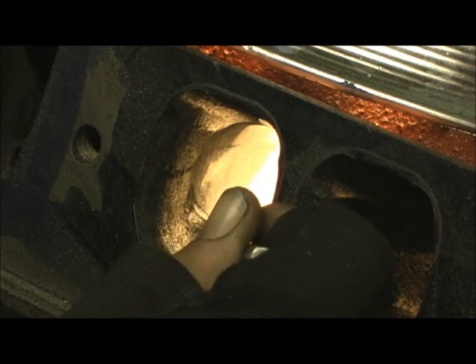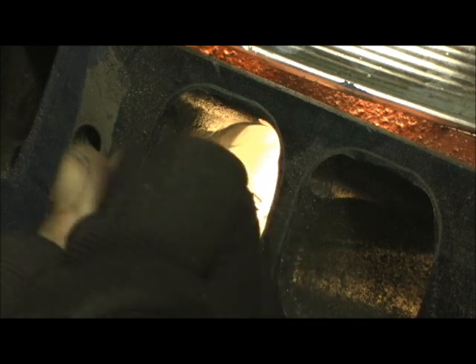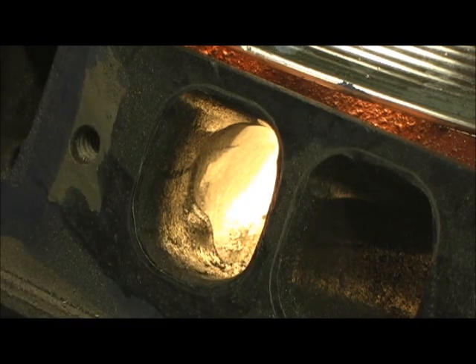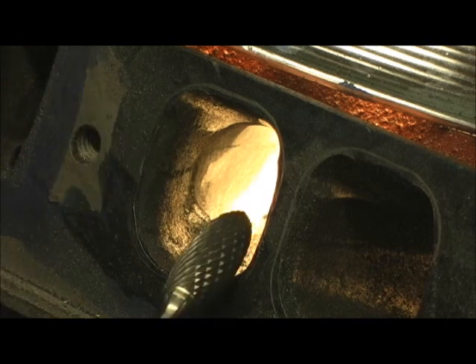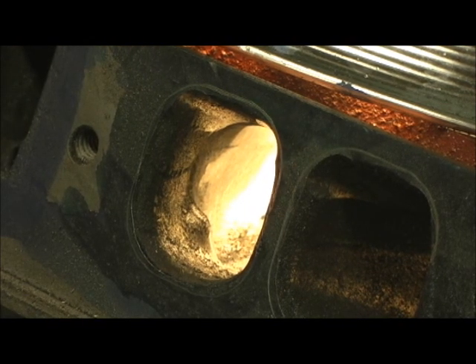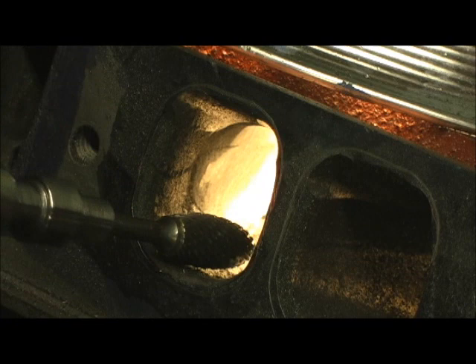What I'm going to show you is how I go in here while I'm cloverleafing and just take that whole son of a bitch out, then form the trench here and here. There's also a center cut to make it balance out to the port on the side, which has long been a problem associated with the big block Chevrolet head. So first we've got to get the butcher hog, go in here, and start at the source — the problem of it. Let's lay waste to this turkey.